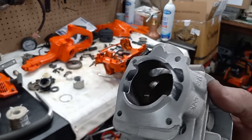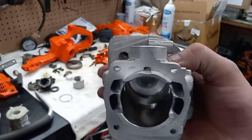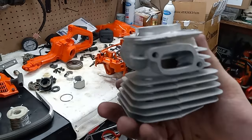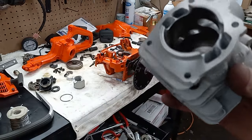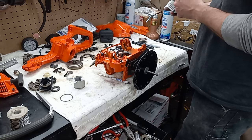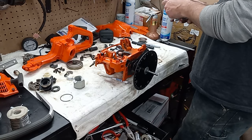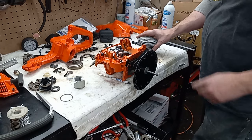A little mellow long — didn't quite go as aggressive with the transfers. Widened the exhaust, polished the exhaust, raised it just a scooch — probably raised it two degrees or so. Cut the chamber to match. The exhaust is sitting at 105, transfers are at 120, intake is 75 on this one.